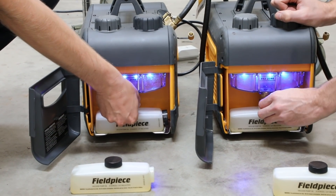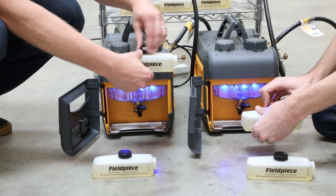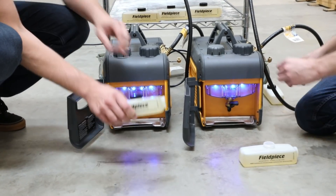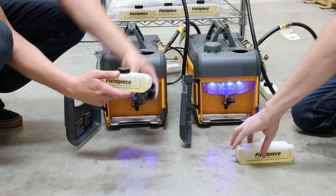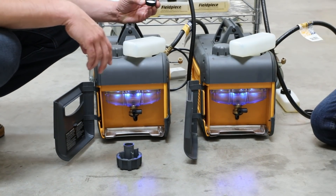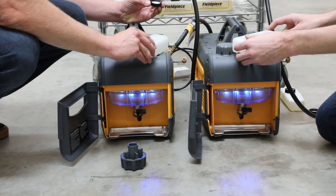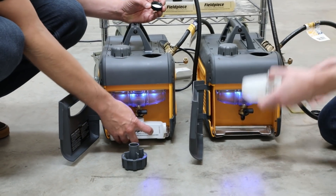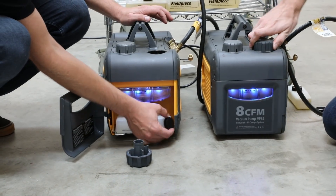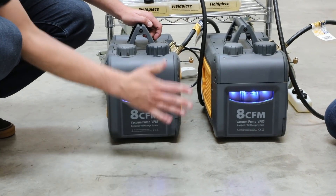Let's close up the valves. You'll notice there's a nice place for the cap right here. Close it and store it right on the side of the tank to get it out of the way. Here's our fresh oil — go ahead and dump it in, and you can see you can quickly add oil right there. Let it drain out the last few drops, put it right back for when we want to change the oil again, get it in nice and tight, and close up the oil fill compartment.